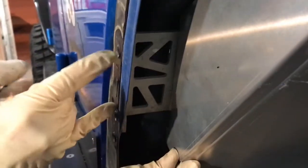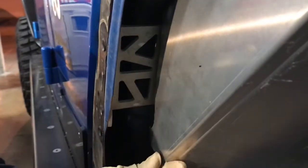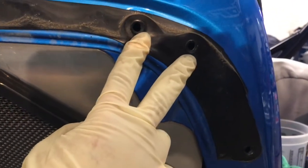Use this as a template and drill these holes out so it goes through this piece. They give you two nutserts which are supposed to go here and here, but you can actually get to these bolts - you just push this back and you can access them.